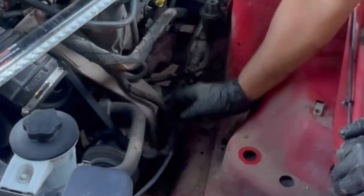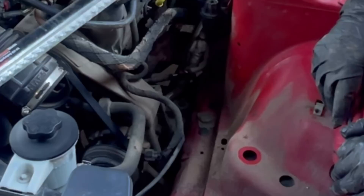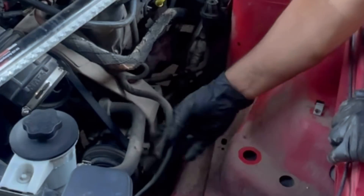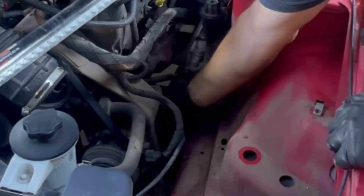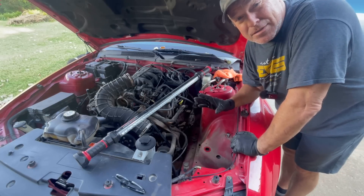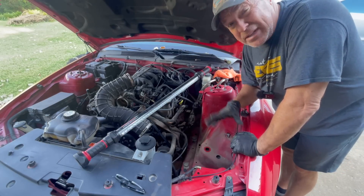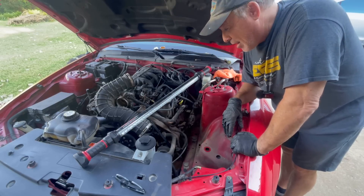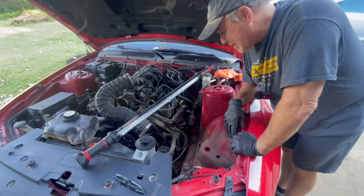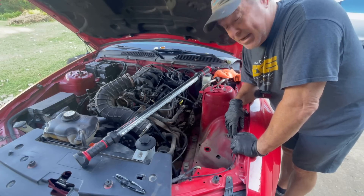To replace this, remove the belt. You've got one, two, three, four bolts or nuts under there — they're 13s. You've got one electrical connector and you have the in and out port, which is held with a 10 millimeter nut. Super easy. We're going to do this with some music so you guys can enjoy it and I can get through this very quickly. So let's see how long it takes to replace the air conditioning compressor in a V6 Mustang.